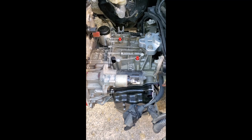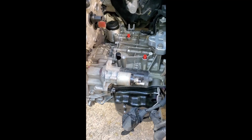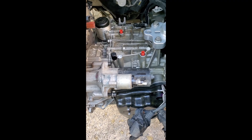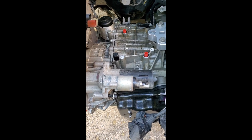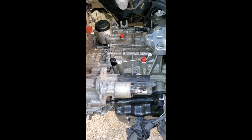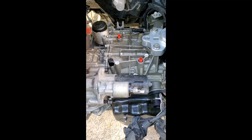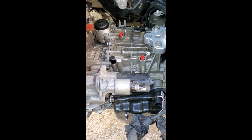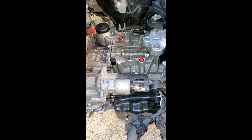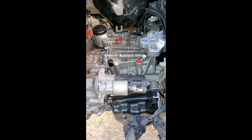Another discovery along with the transfer case: the starter from the DQ250 transmission will not properly bolt up to a DQ500. A lot of this information is not available — there's no playbook that says, if you do a conversion like this, these are all the pieces you'll need. Some guys doing swaps already had DQ250s, and like Malaka Motorsport, they upgraded to a VR6 with their original chassis, axles, and starter matching up, so they didn't face this extra groundwork.